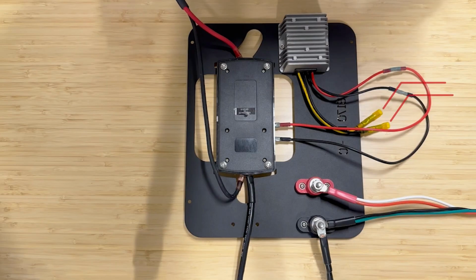The two light leads for the ceiling light harnesses coming off of the cabin wiring harness are going to come together and into the yellow and black wires coming out of your 12-volt regulator. So your red positive leads, if you've already installed them in the fuse block, you're going to need to clip off the fork terminal end, strip the end of the wire on each one of those red connections. You're going to splice those together and put them into the butt connector at the end of the yellow wire coming out of the 12-volt regulator, and then you'll crimp that and heat shrink it.